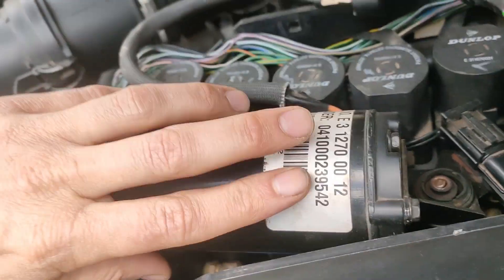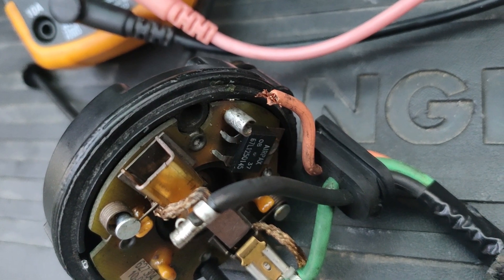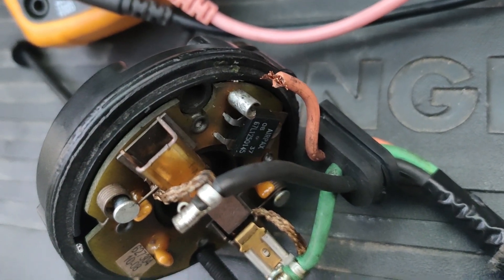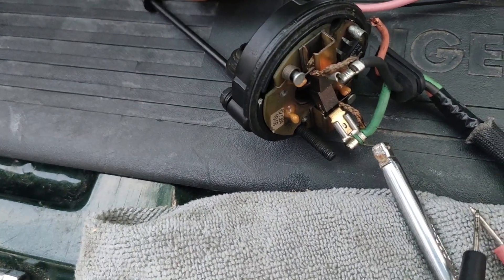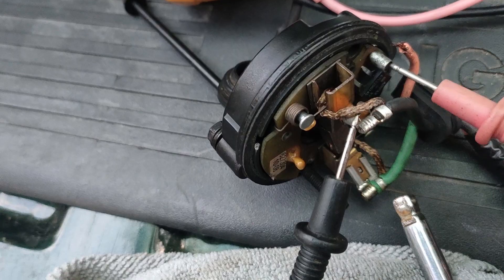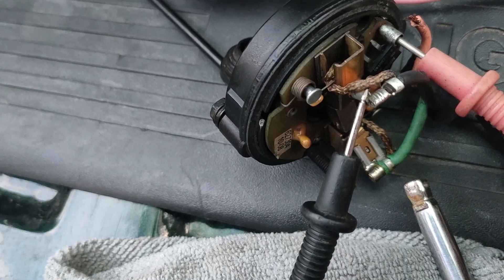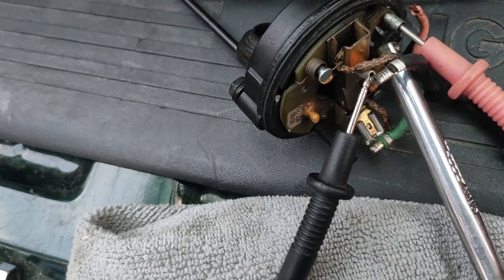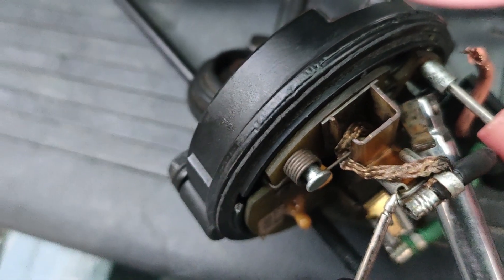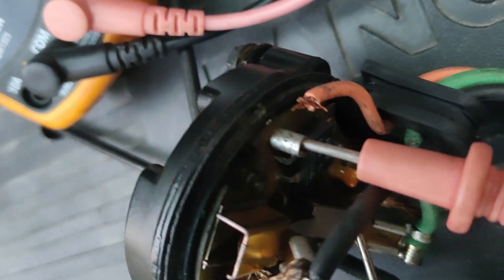I may have to take this out. Right now it should be closed circuit, but it's actually open. We should be getting closed circuit sound. If I go in there, I get nothing. But if I add — so I'm bridging the thermal sensor to make it run.